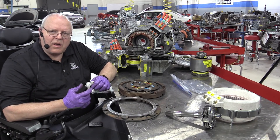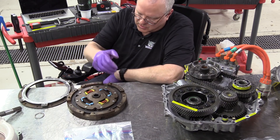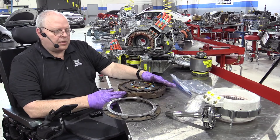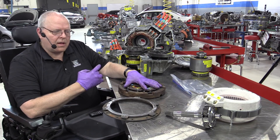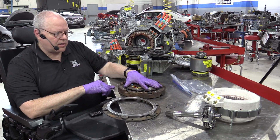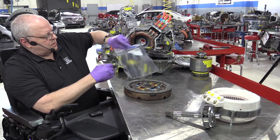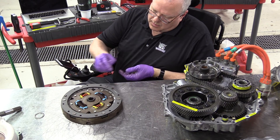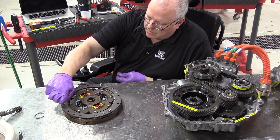As I was reading about the new Chrysler SI EVT hybrid transaxle in their new Pacifica for 2017, they have a clutch disc similar to this except it's inside the transmission — a multi-plate clutch disc — and they call it a torque limiting clutch. I think that's probably the best description of what this does. It limits the amount of maximum engine torque that can be transferred into the transaxle, and it limits the maximum amount of transaxle feedback torque that can turn the engine crankshaft also. So we've got this pressure plate, some alignment holes, and some bolts that permanently apply the clutch disc.